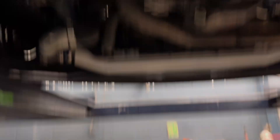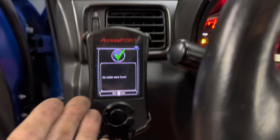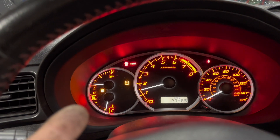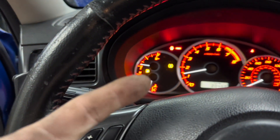Next up, we're going to let the car down, put coolant in it, and we should be good. I got it idling right now so it would pretty much burp the system and get all the air out of the cooling system. Before, I had a check engine light on for the O2 sensor, and the air pump was throwing a code too. Come to find out, a clamp had slid back just a little bit and caused a leak, which is what threw that code — something I needed to address for the past couple days. We fixed that, cleared the O2 sensor code, and now we have no codes.